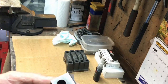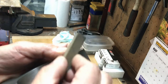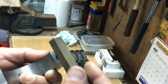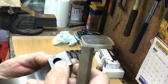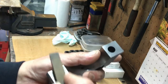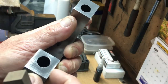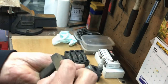On the mating faces, use the fine stone in a circular motion. Don't be tempted to use a back-and-forth motion because you'll tend to rock over the edges. Stay in the middle and do a circular motion — you'll feel if you've got any edges because you'll feel it pick up. You mustn't go too mad with it; you're not trying to remove material, just take away any little high spots.